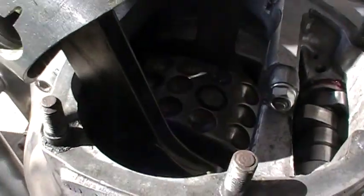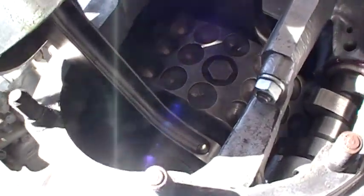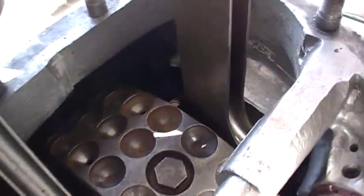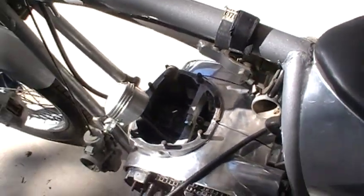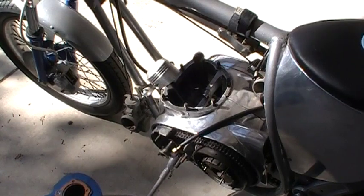Right, so here we've got an A10 crank in there, and it's a little bit hard to see, but the Carrillo conrods, A10 crank, and a little bit of a hot rod cam as well, that strokes an A65 from 74 up to 84mm, so 10mm stroke. We'll go over here, I'll show you that in a minute.